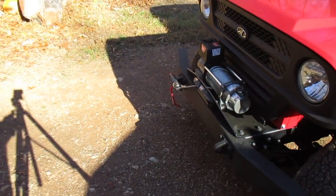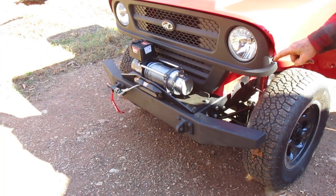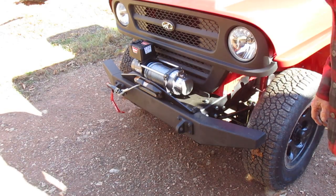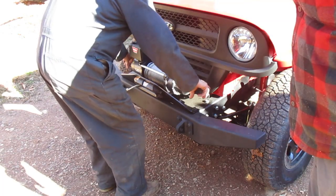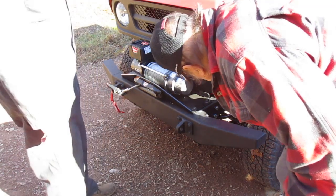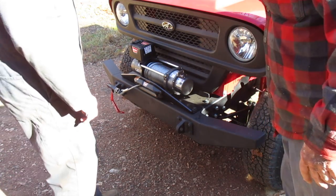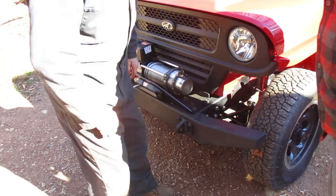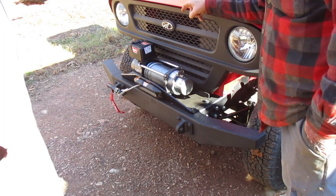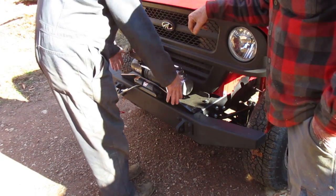It's not a V-blade — you want a V-blade. Myers doesn't make a V-blade. The bracket wouldn't fit right on the front bumper because it has to have more support. You'd have to have some kind of gusset back in here, come out and support in here and here. That frame goes all the way back — it needs more than that when you're picking up a heavy blade. They got the supports in the back hitting on the frame in two different areas. It's good enough for an 8,000-pound winch pulling this way, but a snow plow pulls a different way.